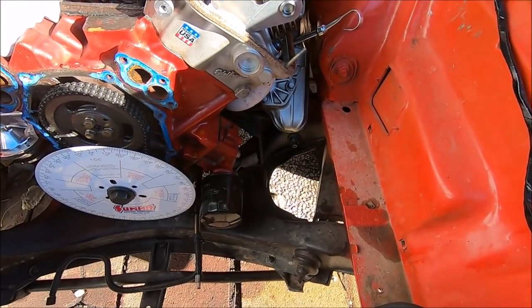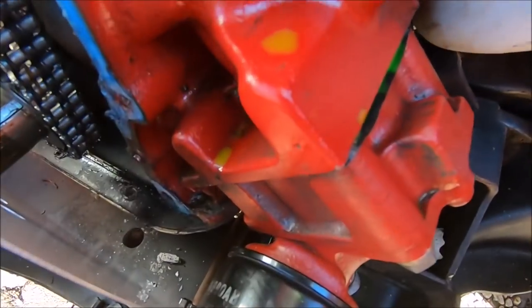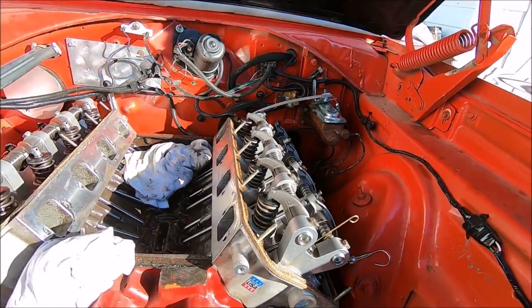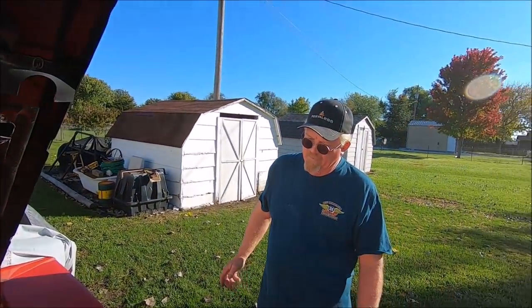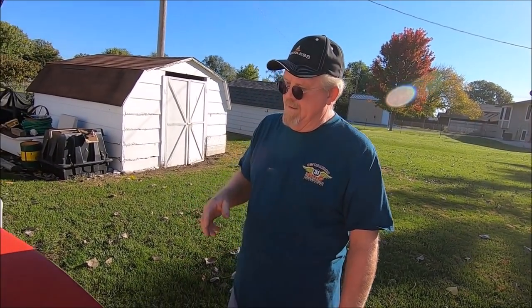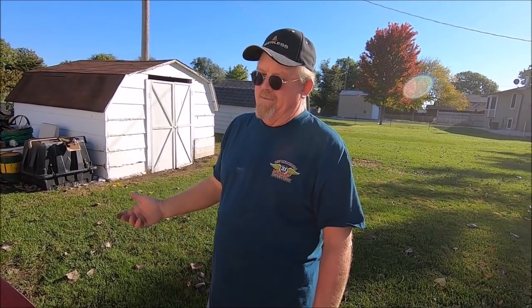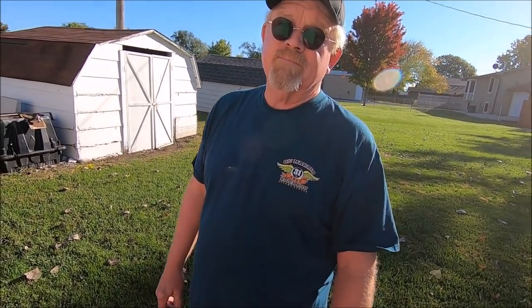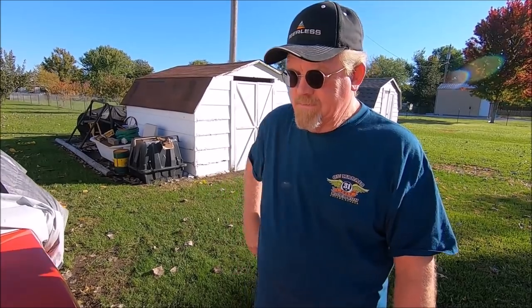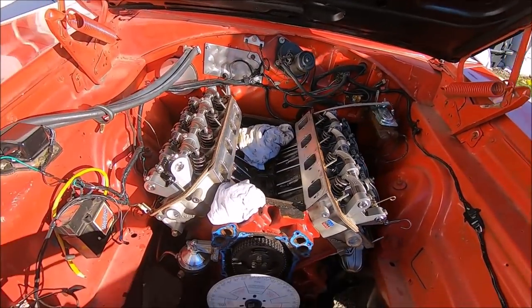We gotta get the oil pump taken apart because the gasket's bad right there, where it attaches to the block. And what else were we doing? Well, once we get the motor where we think it's supposed to be, I don't know whether I'll go ahead and put the motor back together and fire it up and see how that torque converter does. Oh, that's right. And if the car still acts stupid, we got a bigger stall converter, a B&M Holeshot, 3,000 RPM. And that's gonna be a major project. That's exhaust taken off, transmission, drive shaft. That'll be a lot of fun.